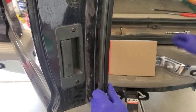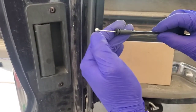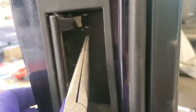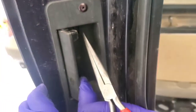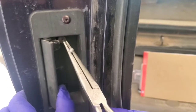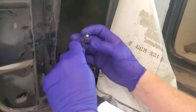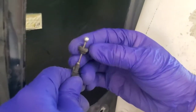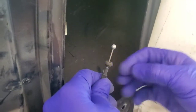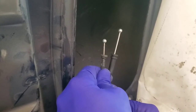Now we're going to start removing the cable on the door handle itself. On the end of the cable there will be a ball. What you're going to do is take a pair of needle nose pliers — this area right here slides up under into this plastic piece. Grab ahold of it with your pliers, pull down, and there's the end of it. Then you'll want to pull it back through. As you can tell, this piece is broken off here, and I would highly suspect it is also broken off on the bottom due to pulling back and forth — it just got old, brittle, and broke.